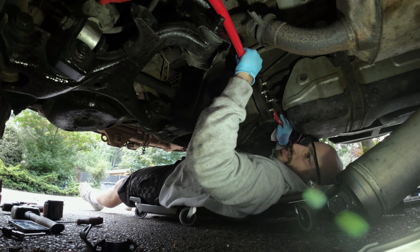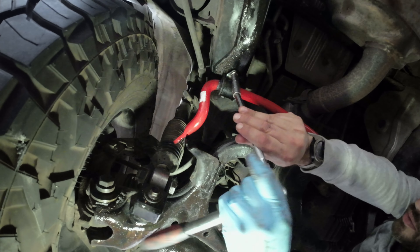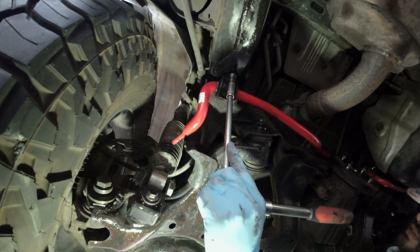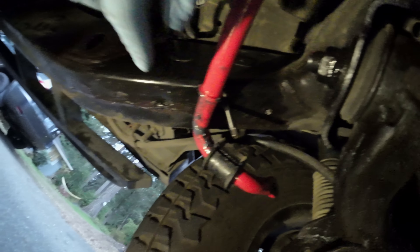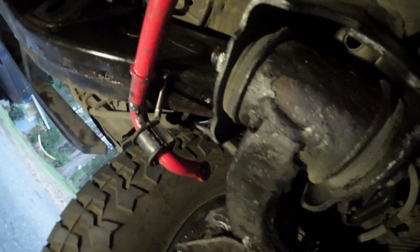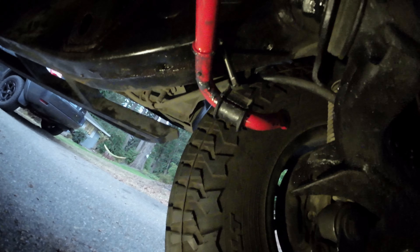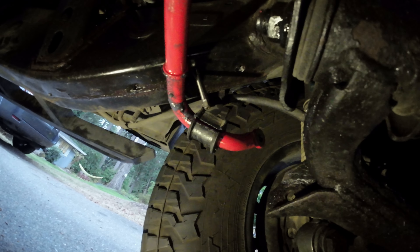We've got them finger tight. Ever so gently, without a gun, we're going to see if we can get these in and have them hold. The back one is plenty tight. The front one isn't there yet — I could probably throw a helicoil in there if it's not playing nicely. So I drilled the hole a little bit bigger, and now we've got a helicoil tap going in here — and this is definitely the friction I'm used to. The other holes were much easier than this, so I made myself a nice little tapping apparatus — a ratchet extension down to the threading stud — and I'm just taking my time getting it in. I have a feeling these threads are going to be just amazing.